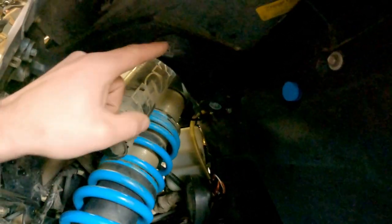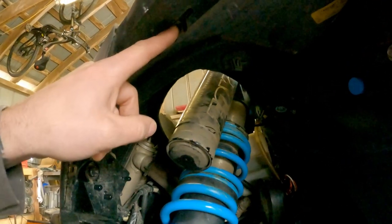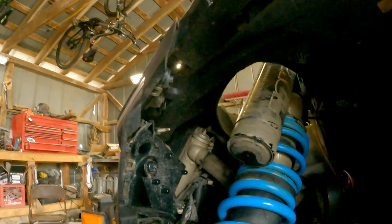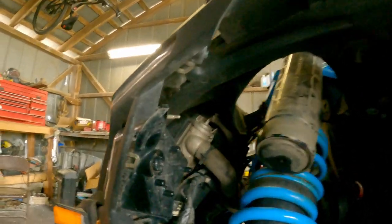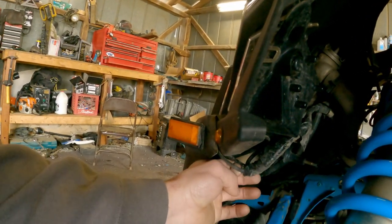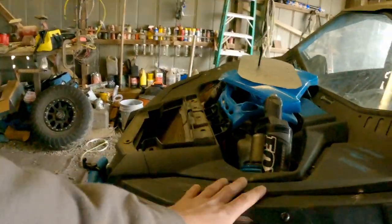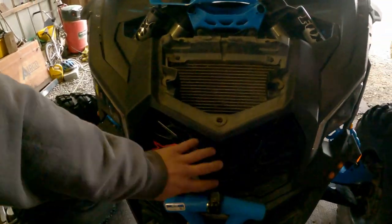You've got three clips: one here — it has a little plastic washer on it, don't lose that — a clip here, and a clip above your light right there. After you have these all removed on both sides, disconnect your lights. I think it's just the lights you have to disconnect. Then you can pull this off.